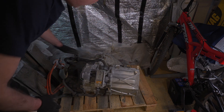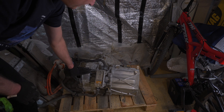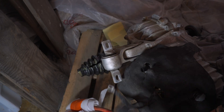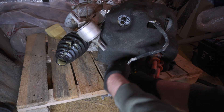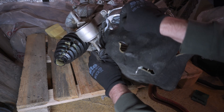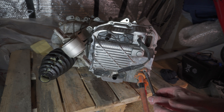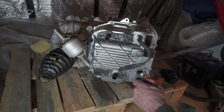This is the motor part and this is the inverter part, so we need to gain access to the inverter. My goal for this task is to remove the Tesla inverter cover, but to gain access to the cover I first need to remove the cooling pipes and the black foam cover that isolates the inverter top. I also decided to remove the high voltage cables to make my life easier later on.